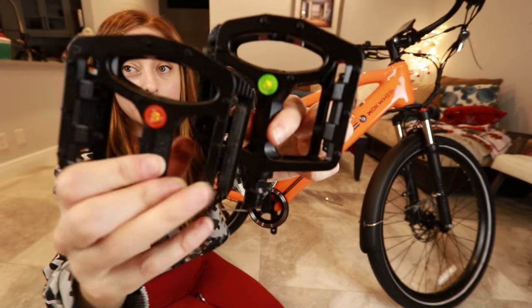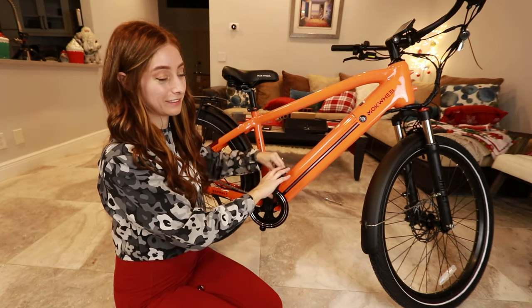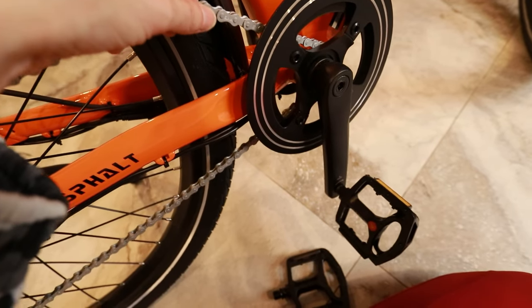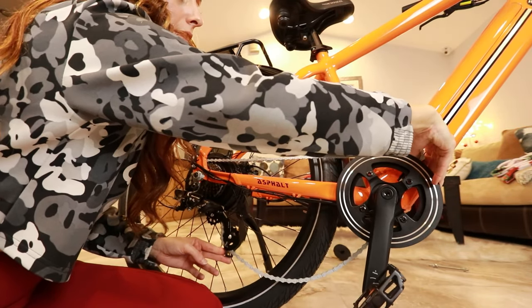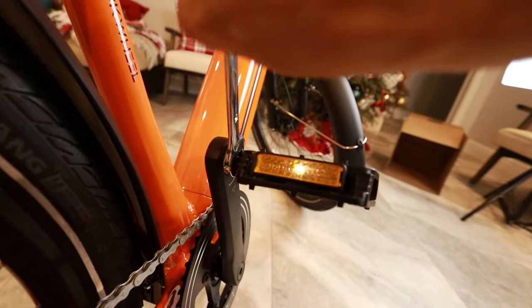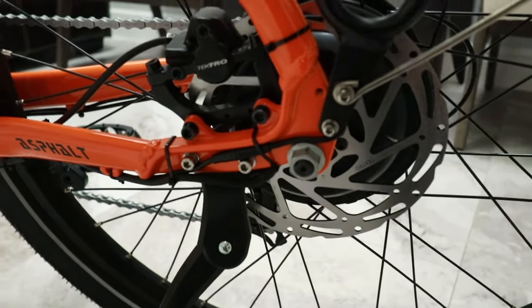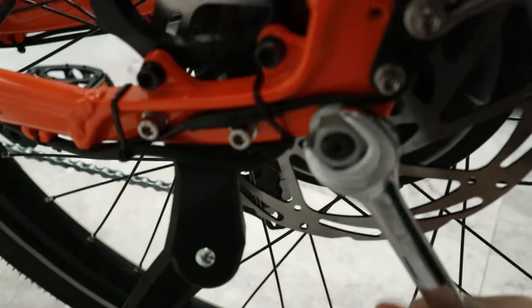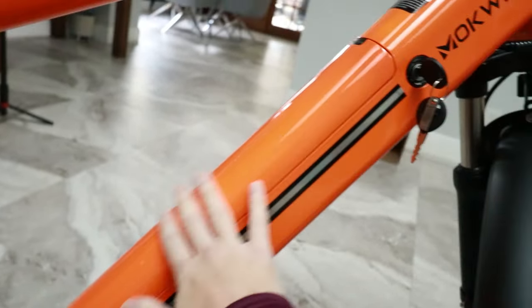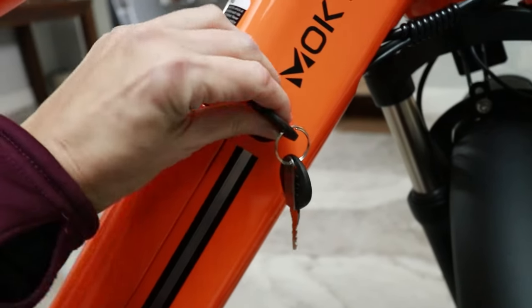And finally the pedals — they are marked with little stickers: right and left. The right one spins in clockwise and the left one counterclockwise. It appears the chain came off — no big deal, that actually happens pretty often in shipping. I pull down on that, put the chain back on, and use a wrench to tighten down the pedal. Something I should mention: even though parts already come assembled, you want to double-check and make sure everything is tightened down. The battery is hidden in here and can be charged while it's in the bike. If you want to remove it, just turn the key and it pops out. The key is only for the battery — you don't need it to start the bike.